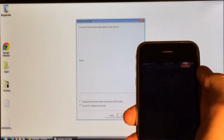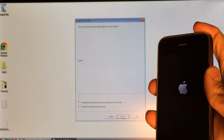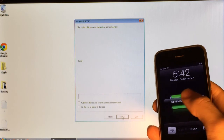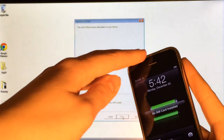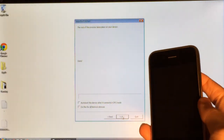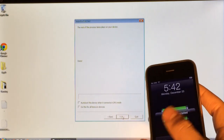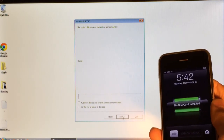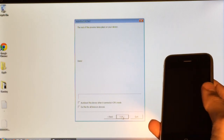Hold down the power button and slide to power off. Once it's fully off, hold the power button to turn it back on and give it a few minutes to boot up. If you're having trouble — if it's hanging at the Apple logo and not getting past it — hold the home and power buttons for 10 seconds. Your device will flash black, go back to the Apple logo, and should boot up fine. Wait about six minutes before trying that; it should boot up fine on its own.